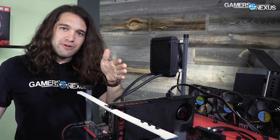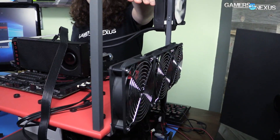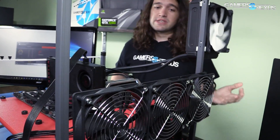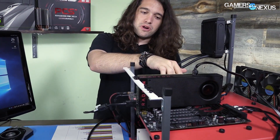The liquid cooler is set to silent — the only noise it's making is from the pump, which you can't even hear over this fan. The 120mm case fans are all unplugged because we're doing noise tests, not thermal tests. So noise comes mostly from the power supply and CPU cooler pump, and now the video card, which is overwhelming all of it. When reading decibel charts, keep in mind it's logarithmic — you can't do normal subtraction to get a delta; it requires a logarithmic formula, which we show on the site.